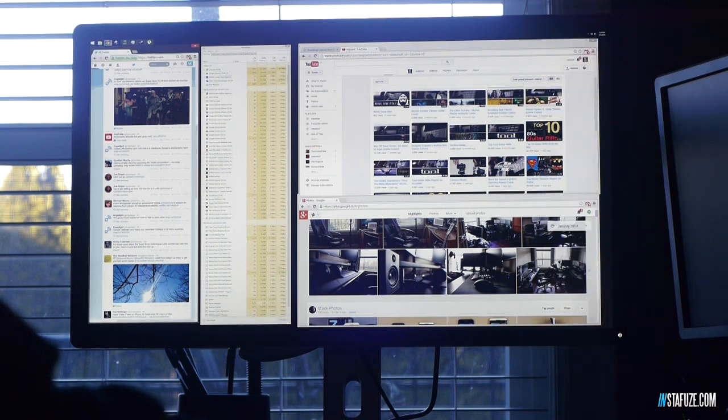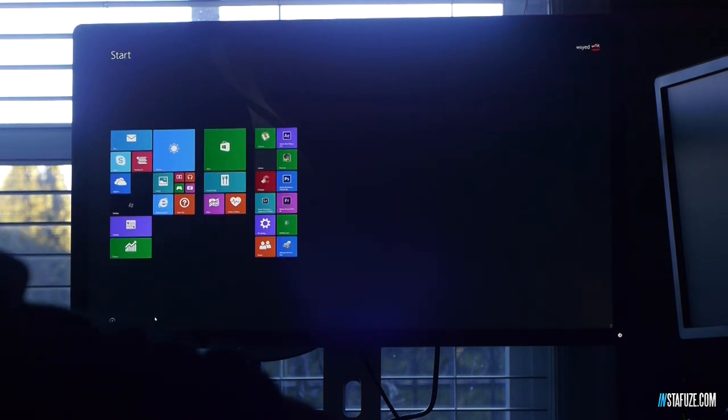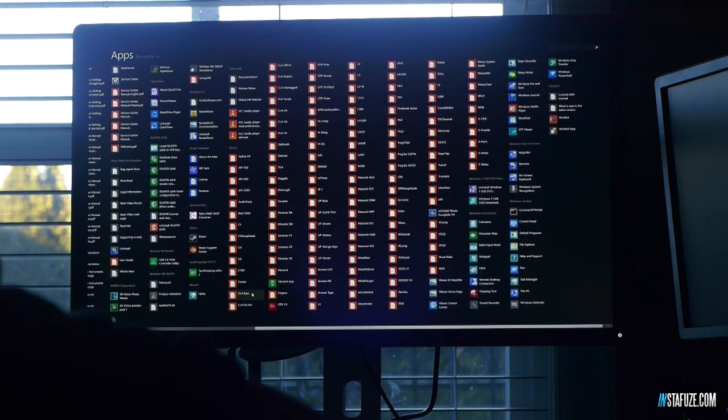One issue you're going to have with this higher-resolution monitor is visual strain. Because you're now looking at something with a much higher pixel-per-inch density, your eyes are going to be concentrating on smaller and smaller text. If you do a lot of web surfing or text reading, you'll have to sit a bit closer to the monitor because the pixels are so small at the one-to-one ratio. A solution is to find a happy medium — which is what Apple does with their Retina displays. They basically double each pixel resolution of the whole OS, so you can have a retina-style scaling where you still have enough screen real estate but things aren't so small that you're straining your eyes.